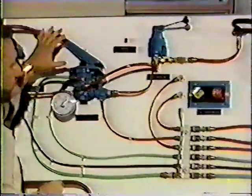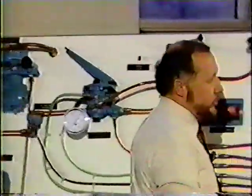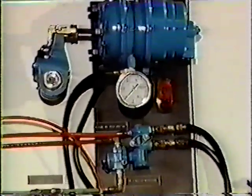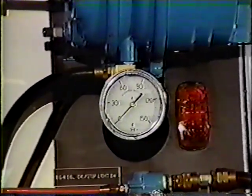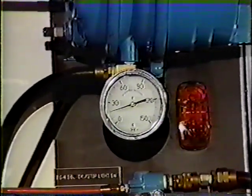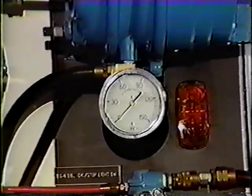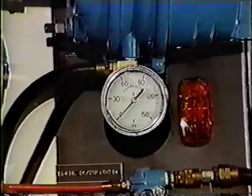Okay, our yellow button is in. I will deliver pressure from the foot valve, and what we need to watch back here is our service chamber gauge. Now, I've delivered about 30 pounds of pressure, and if you can see back there on that gauge, we've only got a slight bit of pressure, correct? Give it about 60 pounds, we've only got a little bit more, not much in that. What I have done here, the brake proportioning valve has dropped the pressure going to that relay valve by 75%, taking the overkill off of that rear axle.